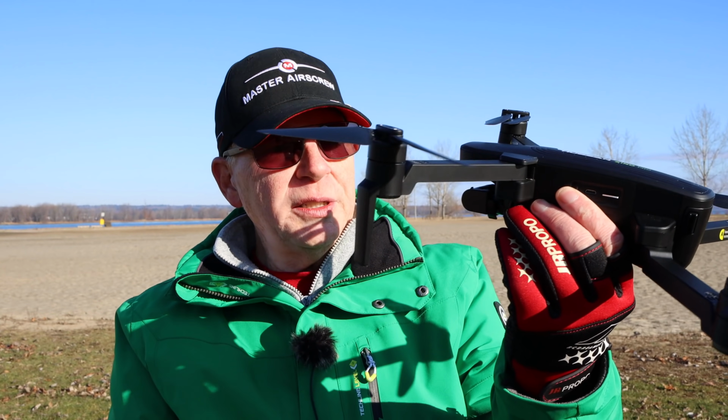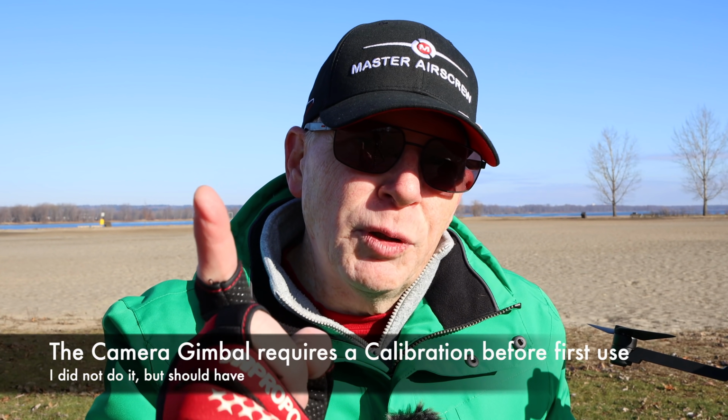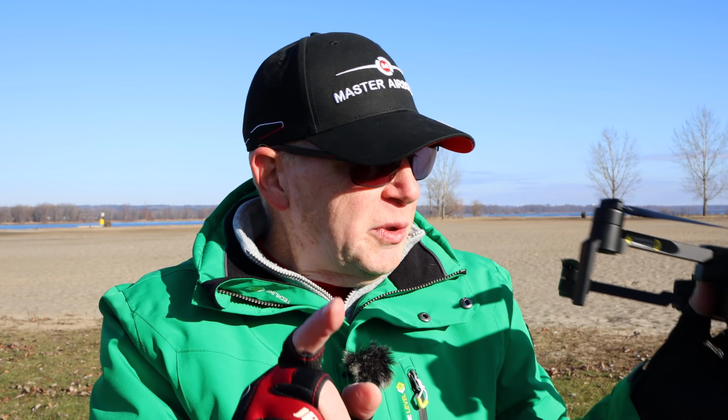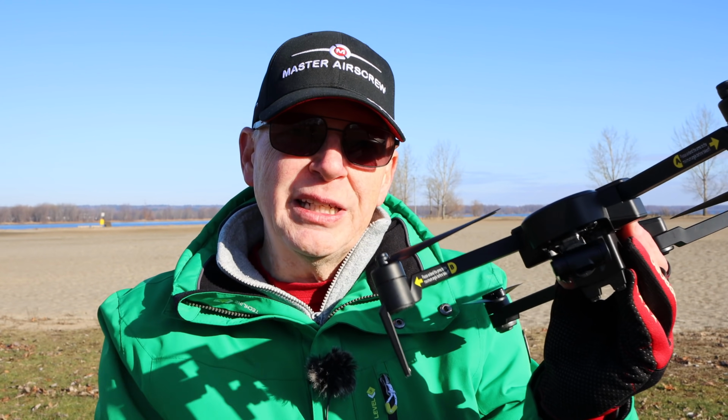The only thing I noticed is the only calibration I did not do at home is a gimbal calibration. I highly recommend you do one. I did not do one. When you're spinning this around upside down like that and the gimbal's on, the gimbal kind of goes out of whack, at least mine did. So I was flying sometimes and I'm going, man, the horizon is kind of wonky. So make sure you do a gimbal calibration at home on a flat surface. It's very easy to do. There's an option in the actual menu to do it in the app, and then everything should work.